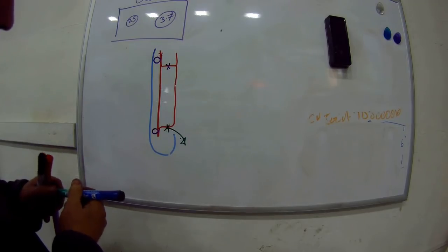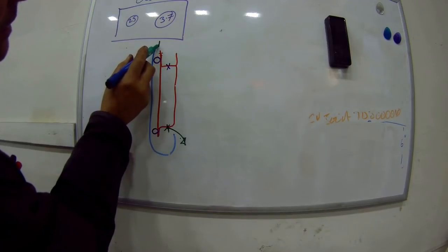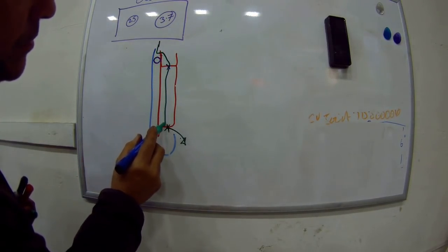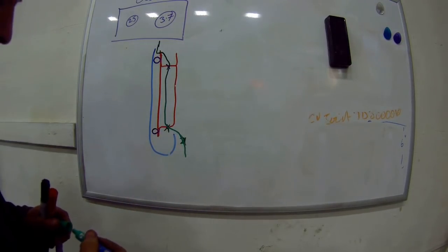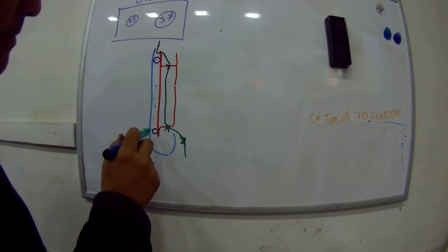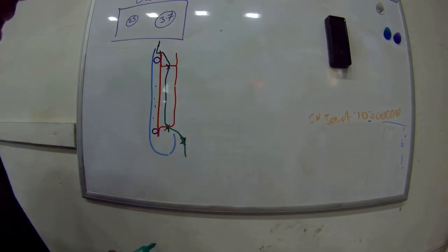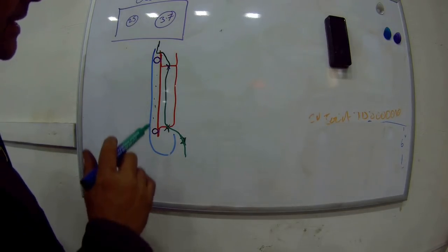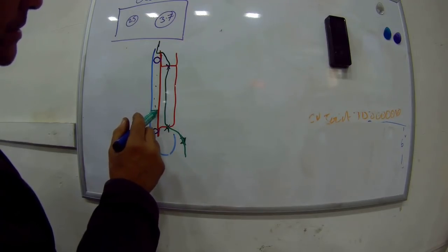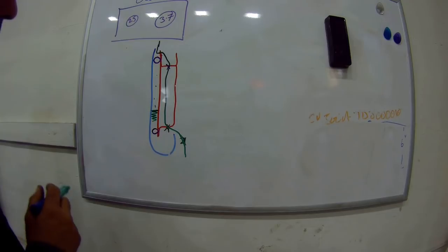is supposed to come down from your window, if you can see that, and it's supposed to go this way, like this, okay? Out the bottom of the door, but it doesn't. It gets trapped in here, and putting mastic in the bottom of here keeps the water in. It's the most ludicrous idea you've ever seen. Again, you've now got electrolytic connections between the steel and the aluminium frame.